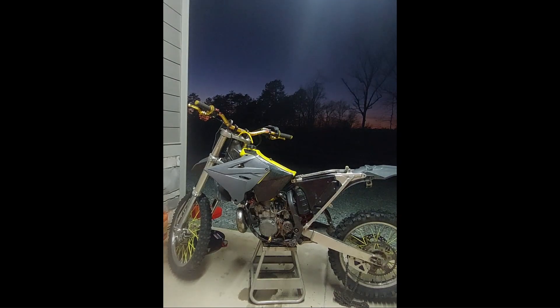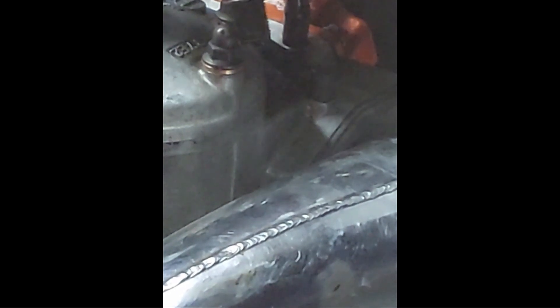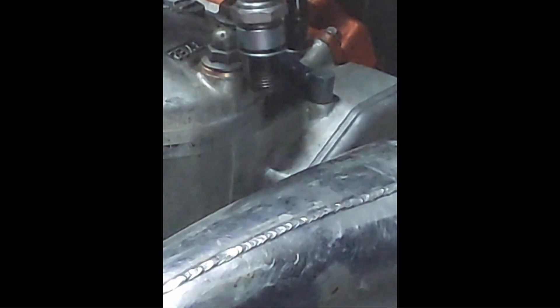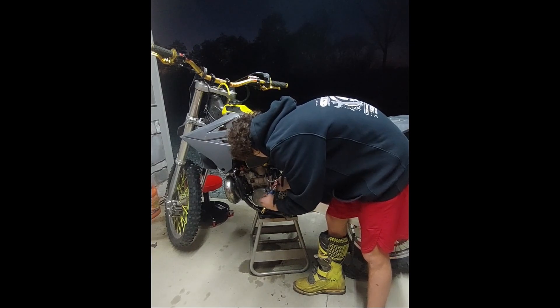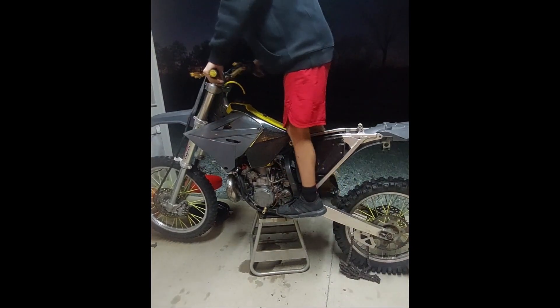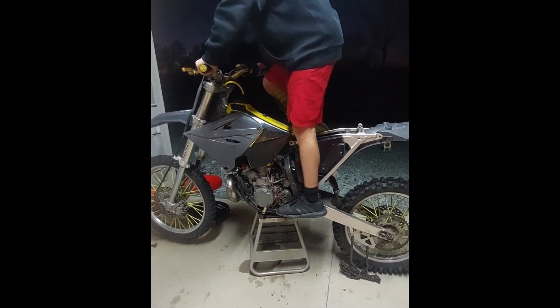Let's see what the problem is. Look at this — three pixels a second quality right here. You can barely even see the spark happening but you get what's happening. All right, we adjusted the fuel air screw mixture by a few turns and a half. It's probably going to idle really high when I start it up — we'll just adjust it from there. Let's see if she goes now.